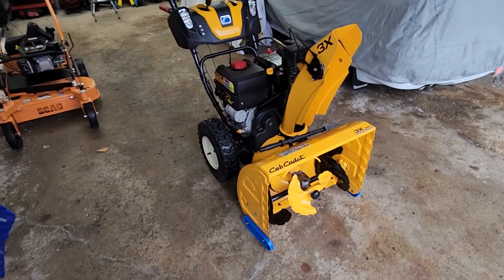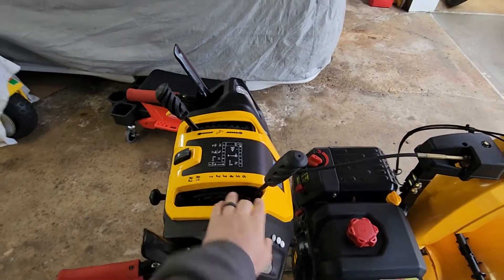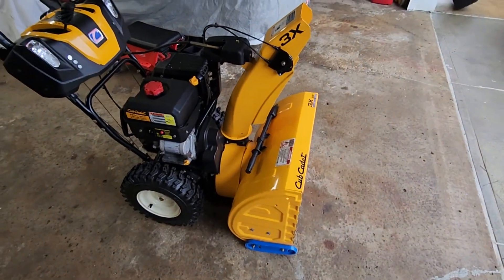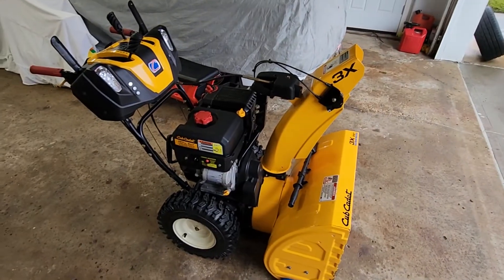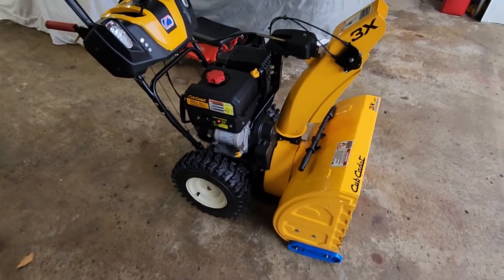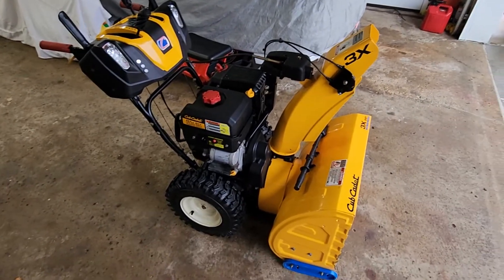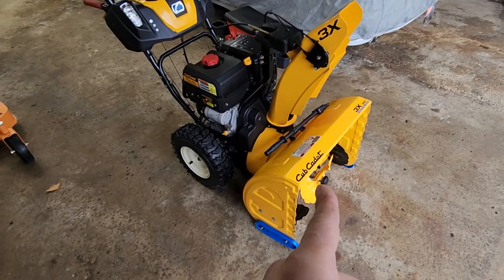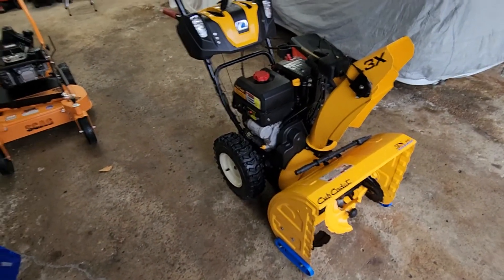When it's very heavy snow, you can see the kind of driveways we have in Twinsburg — some are pretty big. When I'm doing multiples, my average speed with this snowblower is fourth to sixth gear. I usually keep it in sixth gear and I can plow through wet heavy snow almost bucket-high without it spilling out. I can blow through a yard and have everything done and the snowblower back on my truck in about 10 minutes. That's why I absolutely love the three-stage in heavy snow — fourth, fifth, sixth gear, I plow right through it.